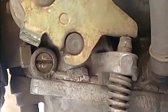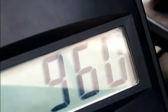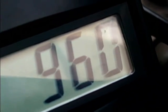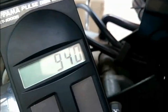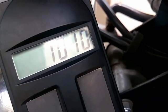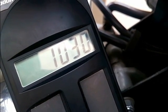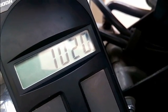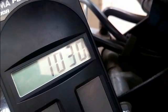Now the carburetor is again properly tuned. I am going to set the RPM according to that. This has to be done when the engine condition is hot. If you do it in cold condition you cannot strike the RPM properly — it will keep on fluctuating. A fluctuation of minus 10 or plus 10 is okay, but not 100 or 200. Now the carburetor is absolutely fine.